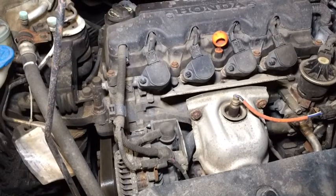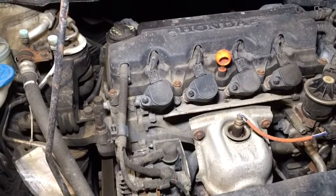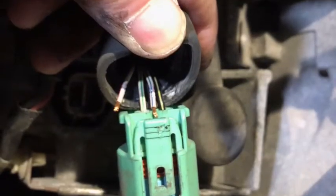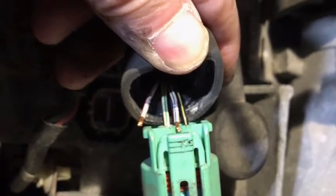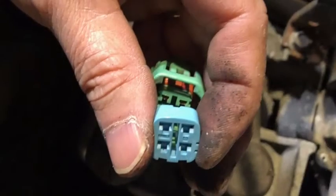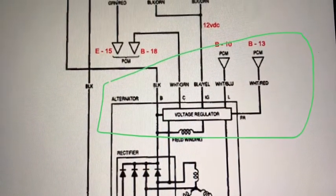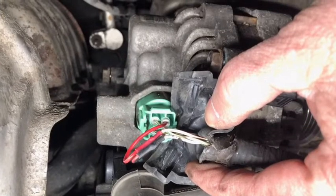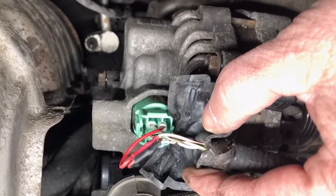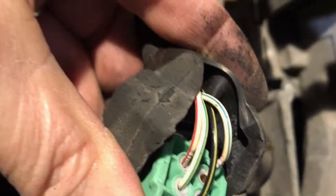The alternator is located right here by the belt. We're going to disconnect the alternator connector. I pull up the boot on the connector and notice the wire is already breaking apart. This is not good news because we now have to repair these two connector wires. I pull the connector apart, check the schematic, identify the wire colors as noted, and repair the wires with some extra jumper wire soldered in place.